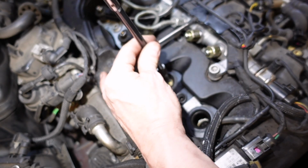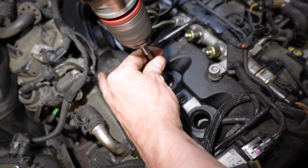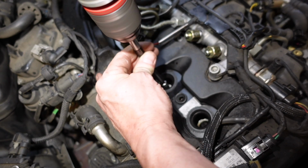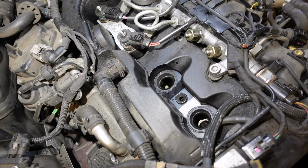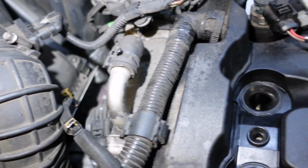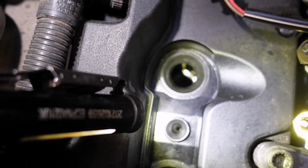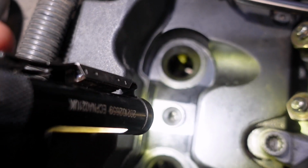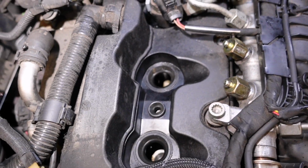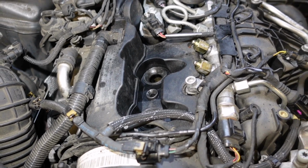And we'll clean out these bores the best we can. It's mostly full of oil, actually, you know. Okay, so we'll give her a bit of a light cut with that boy over there, and this is what we've ended up with. So as you can see, I can get you in down there. So not too bad. It wasn't really too bad anyway, but yeah. And then that wee bolt hole there, there was engine oil in it, so I give it a bit of a blowout because I don't want the oil in the threads. That'll affect the torque. So yeah, so okay.